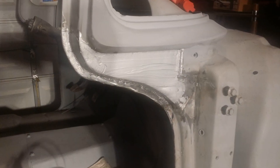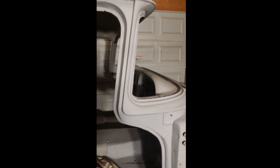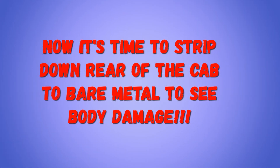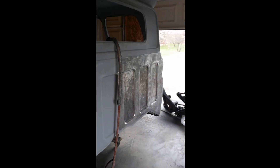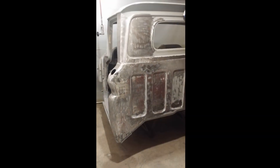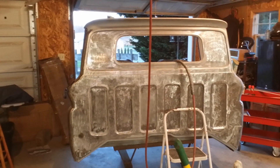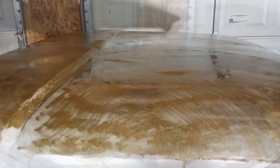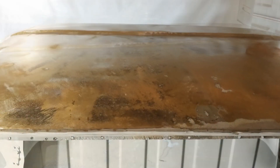This is the old metal filler - I actually use that instead of bondo because it strengthens it a lot. Since on that hinge there with all that metal we need a little bit of extra strength. Now it's time to strip down the rear of the cab to bare metal to see what kind of damage we got. I was able to strip that rear cab all the way down to bare metal - that's the best way of getting your body work done. I found out that this is one of the best ways of killing rust so it won't come back, and it's also a very inexpensive way - using a 50/50 water and vinegar solution.